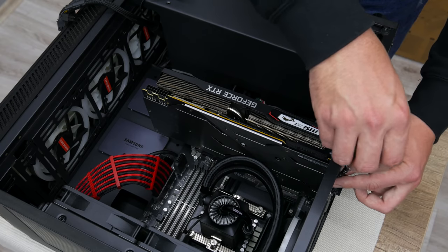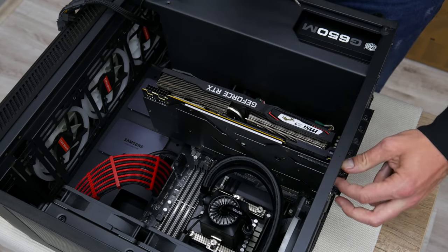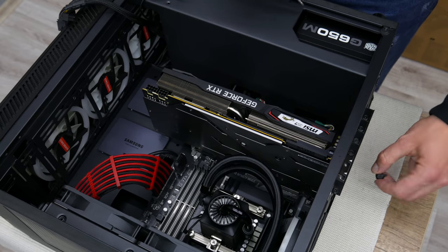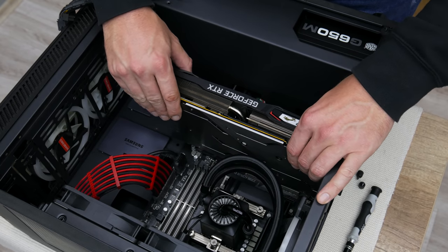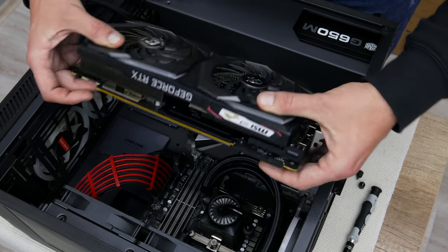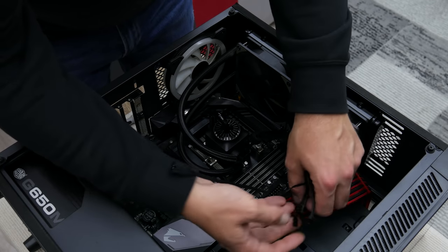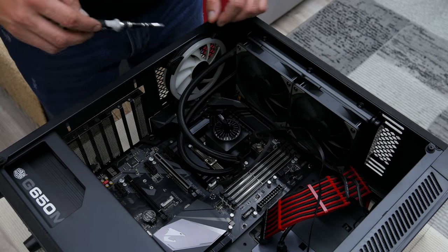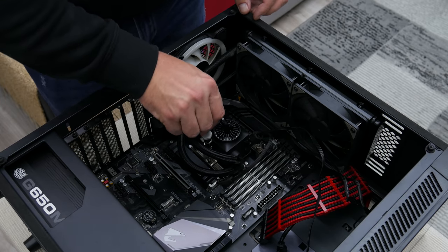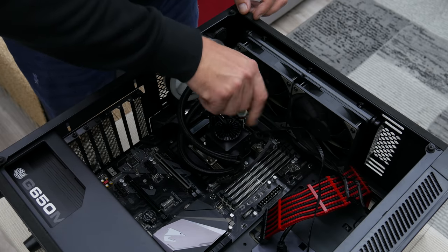The PC case was from my previous build, and the power supply is more than 6 years old. I used the power supply when I had an AMD build. Then I used it in my second build with Intel i5 4th generation, and I used it again in this third build. A while ago, the power supply died. The problem was in some capacitors, which I changed, but I know this will not be a long-term solution.